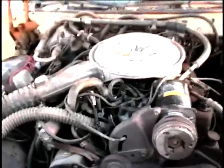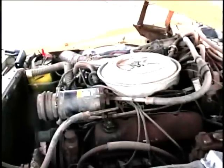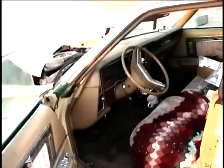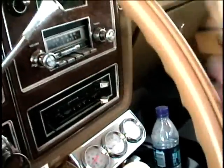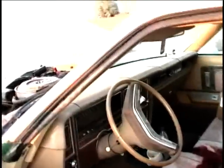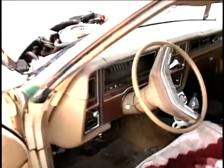This seems really good. I hope it'll continue to start up well — I'm crossing my fingers, I think it will. But this car has been the most difficult thing to start all the time I've had it, although sometimes it's been better than others and sometimes it started easier. I didn't even have to have the choke on. I think the use of the choke might have been kind of a crutch to get it to start, when it really had a problem with the distributor or the pickup coil.